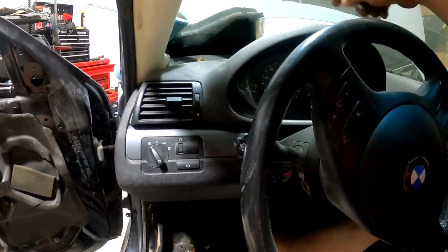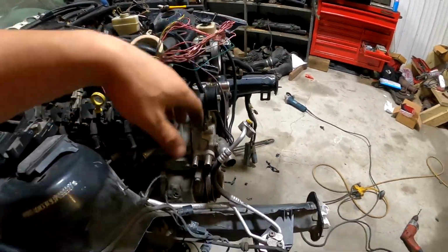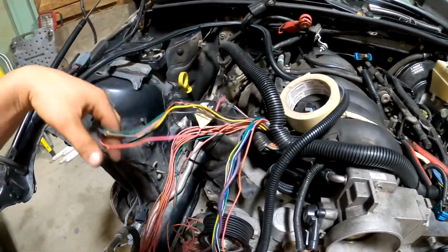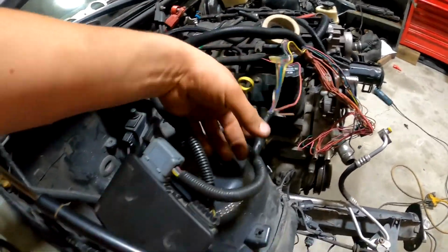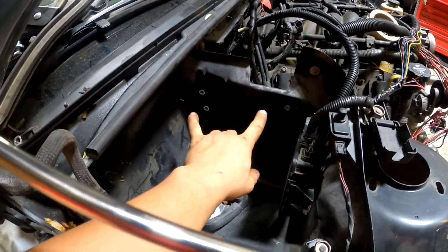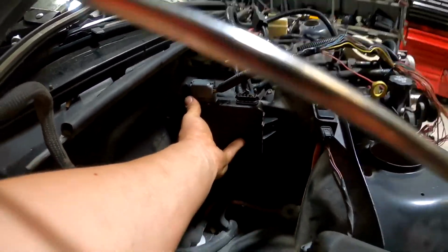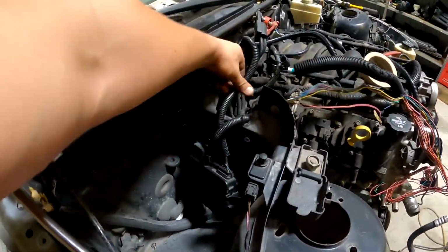So now I'm gonna quickly run wire from the actuator to my pedal. I took apart this pile of harness. It looks like a mess, but it's really not. This is all my positive stuff, and these wires were all together here for the tack, for the actuator. So it goes from here into my tack, and then from here to my pedal. And I drilled holes right here and put nuts in them for those 3 holes. And basically it's just gonna go right here, and bolt it right here, and there's this nice little exit right here for my wires to go out.